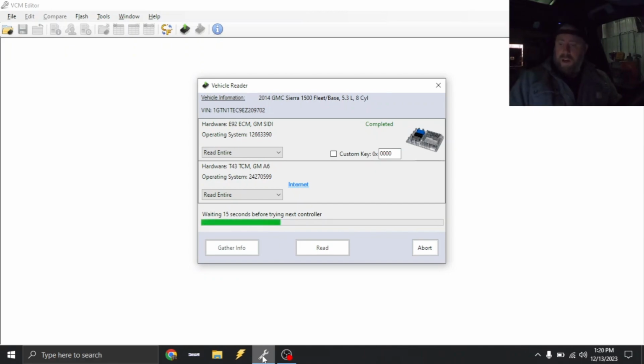So anyways, reading out this file now, what we're gonna do is go ahead and make a torque model adjustment. We're gonna adjust the idle RPM. We're going to put in the injector data, and we're going to scale the MAP sensor. That way I can back this thing up on the rack and it starts clean and runs clean, and then we'll get into the tuning from there.